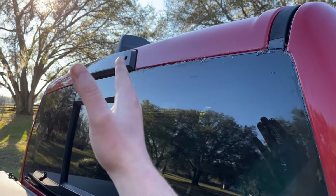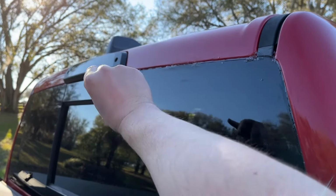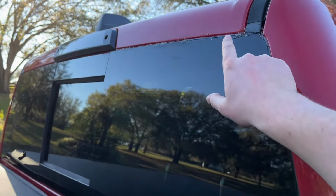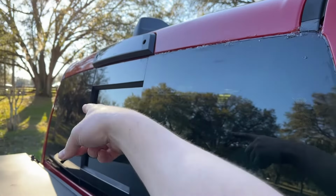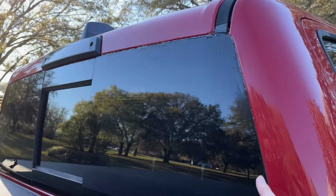And it was right in the center there that I'm pretty sure water is getting in. It gets underneath that channel, follows the channel all the way over, and it leaks over a little bit right there, but the majority of it comes right here and leaks off at the end of the channel, and that is where it was leaking from. So I sealed the entire center channel up. I did basically the entire left side, driver's side, and passenger side.